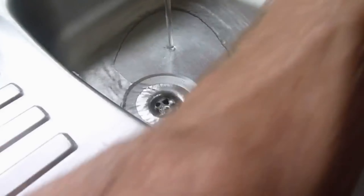A friend of mine had a washing machine going into an outside gully — if the pipe is underwater in a blocked gully, it will not run. Take the filter out inside the machine first to make sure that's not blocked, and if that's okay, go outside and check it's not underwater in a blocked gully.